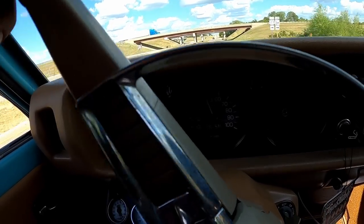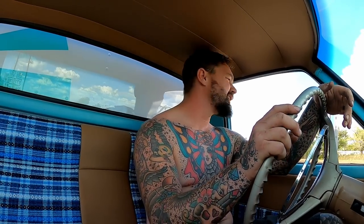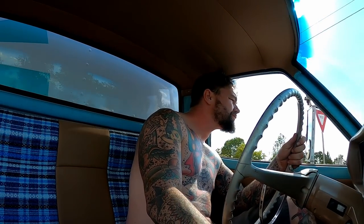Brakes are a little soft still — I think we need to bleed them, probably got a little air in them. I see our speedo's working. We're in third gear going 55. This is the first time I've had it up to these speeds. And she just backfired and died — I don't know what the heck just happened. We're going to get here on the shoulder. Fired right back up. I don't know what happened back there. I didn't feel like it had quite the power on the way back, and she just died funny.